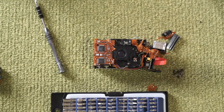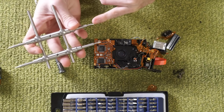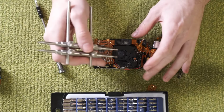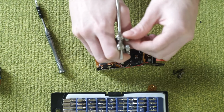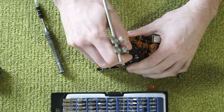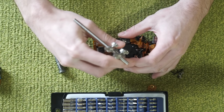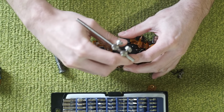All right. This is a pair of lens spanners. You have these flatheads on one side, and you have these spiky-looking bits on the other. But these are very, very helpful when you need to get out a lens element like this. You simply set them into their grooves, tighten up all of the screws, and then very gently spin that lens out. I try to switch to using my fingers as quickly as possible, just because having sharp metal pointy things near glass freaks me out.